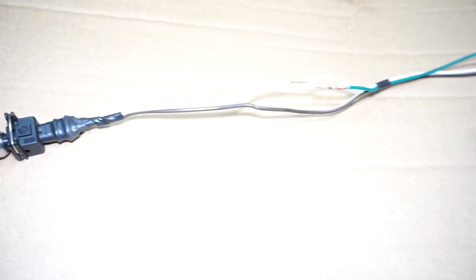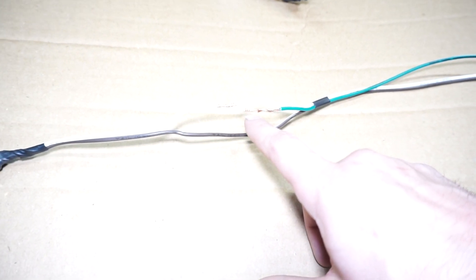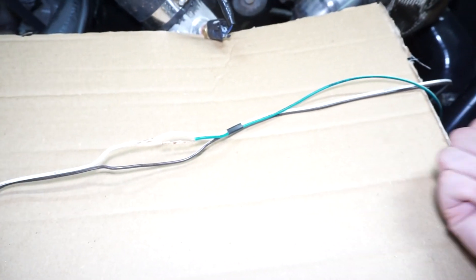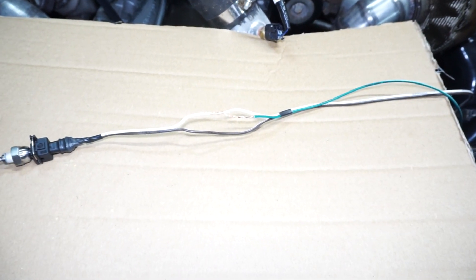When the five volt is hooked up, it's going to increase the voltage coming out of the white wire instead of being reduced by the resistance. There's a 2.2k ohm — 2200 ohm — resistor in here, and what this does is basically boost the signal back to a usable five volt analog output that we can calibrate and use in the Terminator. Some of you may be familiar with pull-up circuits from LS swaps — I had to do a 12 volt pull-up with a 1000 ohm resistor on the tach signal on the P59 computer in the Ranger. You run the pull-up circuit, it boosts the signal to a high enough voltage to be usable.